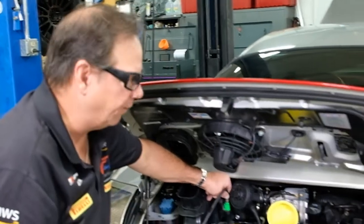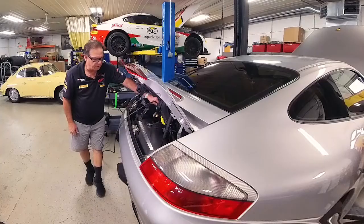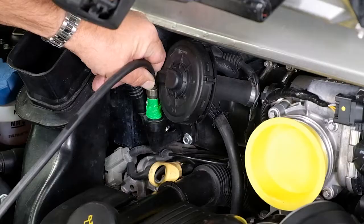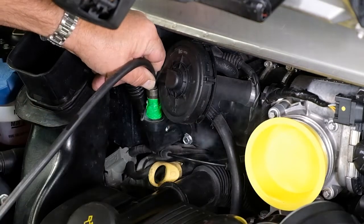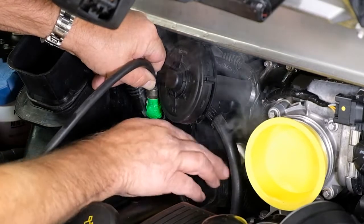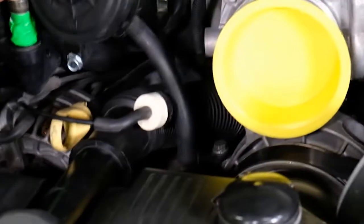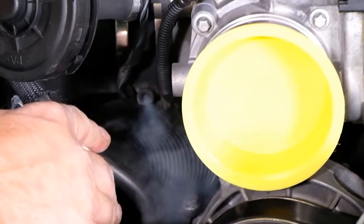You want the engine to be around ambient — about 40 degrees Fahrenheit or above. Let's create a little vacuum leak here and you can see the smoke coming out. I'll show you the origin of it — a little tiny orifice down there; you can see it coming out right at it.